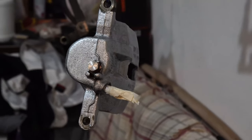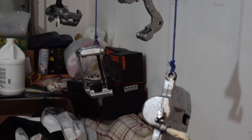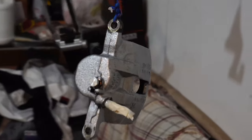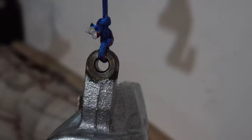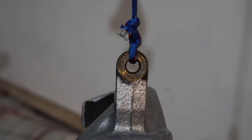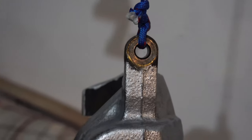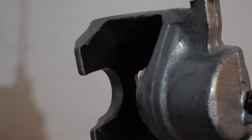You're going to wait 15 minutes to apply the second coat. I'm about to start the second coat — it's definitely over 15 minutes already, but that's okay. You'll notice I did not paint the part where I touched it, because I'm going to paint that very last since it goes behind the rotor and you'll never see it. I'll just do a very light coat at the very end to finish it up. You don't have to paint the inside where the brake pads will be, but everything on the outside is good.